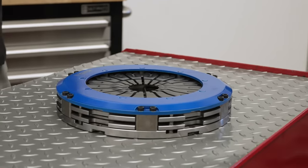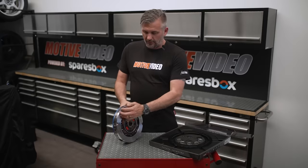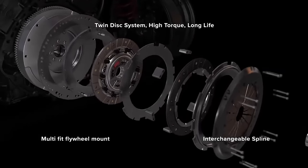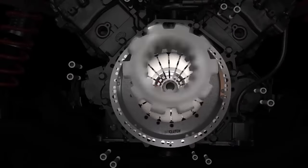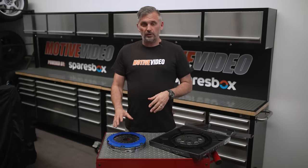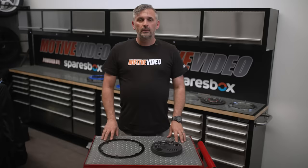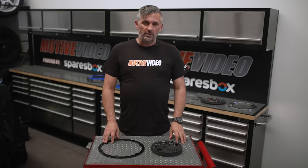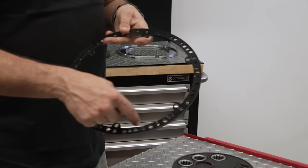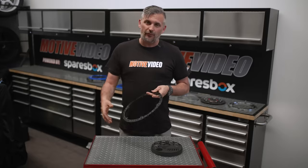So the big question is how. The Uni-Clutch comes pre-assembled as one complete unit. It has its own flywheel surface, the clutch disc, the intermediate plate, and the pressure plate — all pre-assembled and pre-aligned. You don't pull it apart when you assemble it onto the car. That comes in one box, which means wholesalers can keep a bunch of clutch units put aside, and then you have a fitting box. To make the Uni-Clutch work on different engines, you have this ringed adapter. Basically, it attaches to the twin-plate clutch, and all these different bolt holes on the outside will suit different flywheels.